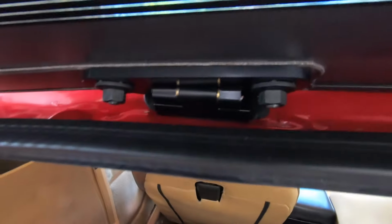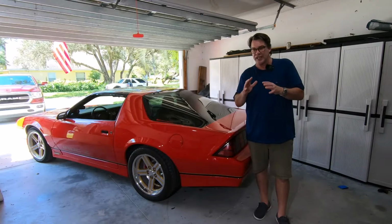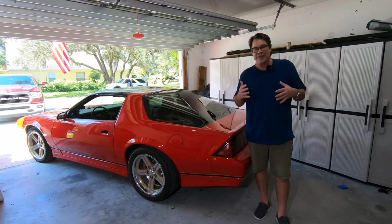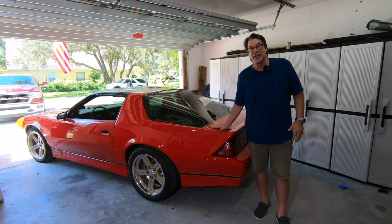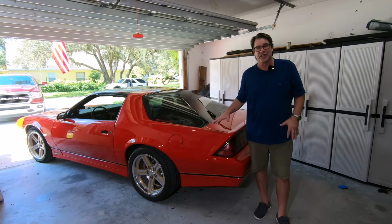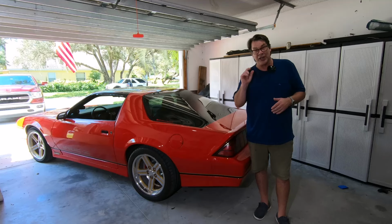Very cool stuff. The biggest thing is the glass. If you look at the thumbnail of this video, I've gotten all kinds of pictures and photos where people broke their hatch glass because they torqued it too much. That's the biggest thing. It's really an easy job, especially if you have two people. You should be able to get it done in a couple hours easily, just taking your time with the alignment mostly.